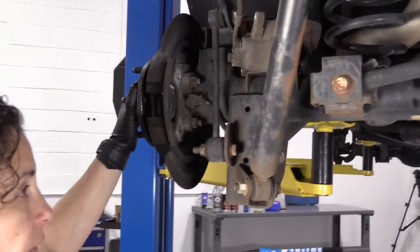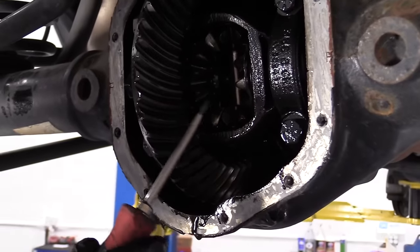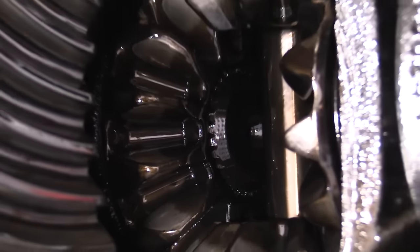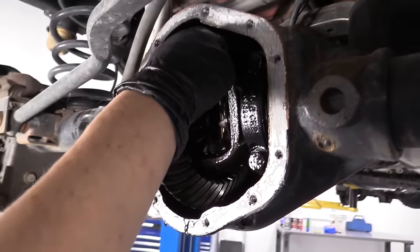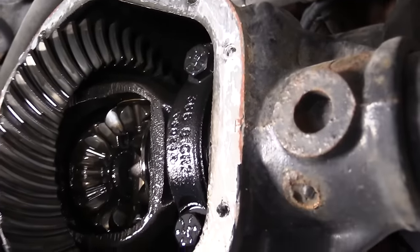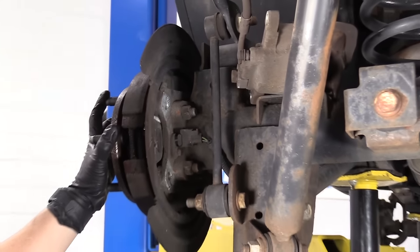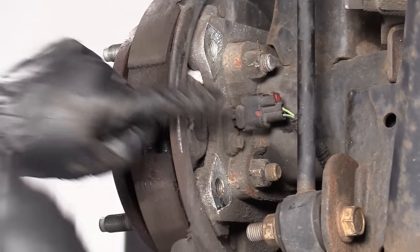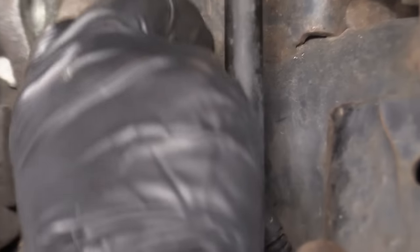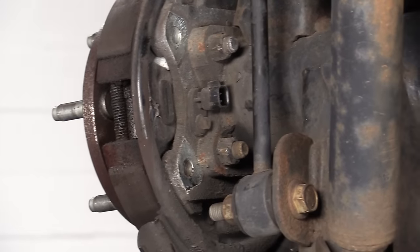So now we're going to take the axle out on this Jeep. The cover's off the rear diff so you can see the gears and the pinion gears in here, and the shaft is right there. On other makes and models like a Chevy, Ford, some Chryslers, there's an actual pin that goes in here for the pinion rear diff pin. This is not — these seals are bolted on to the back of the hub tube, so we have to take the whole axle and the seal comes out together. The first thing we have to do is remove the ABS sensor connector — it's got a lock tab on it, that red piece. I'm going to pull that out, then push down on the tab on top and slide it right out. I automatically put the lock tab back in so I don't lose it.